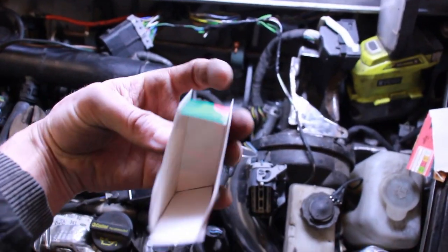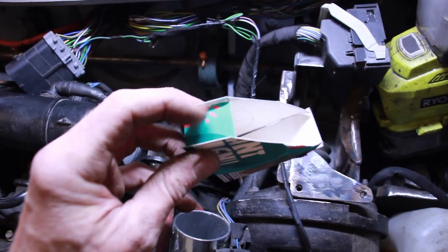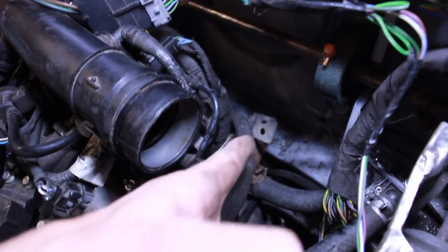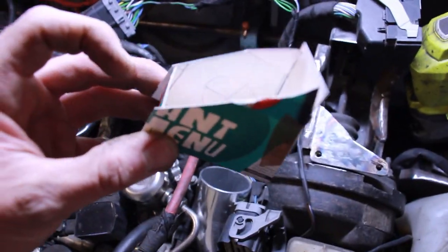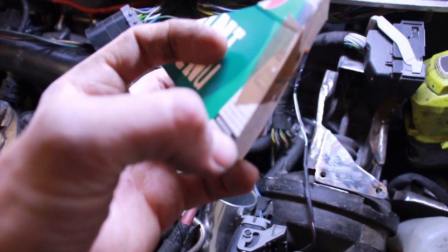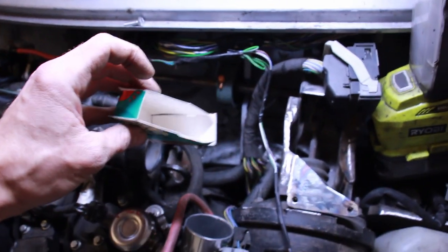Here's our second, slightly more difficultly worked out bracket that will sit down in there. And this obviously little seat flange is where this will sit on top, so we'll weld that piece there. So we'll put a hole through it and weld a nut behind it, a couple of speed holes which you can probably just see in there, and then a little cutout at the bottom here. We'll make a little cutout there, because obviously if there's water sitting in the bottom there, that's going to rust in through all day.